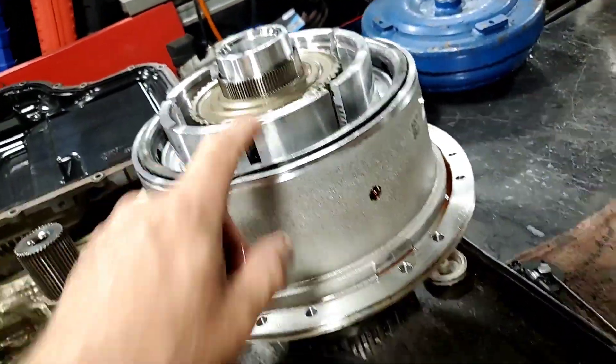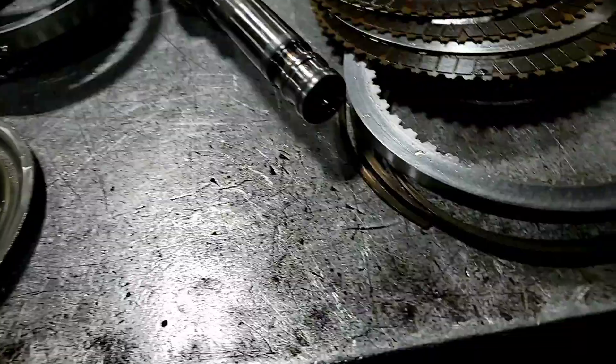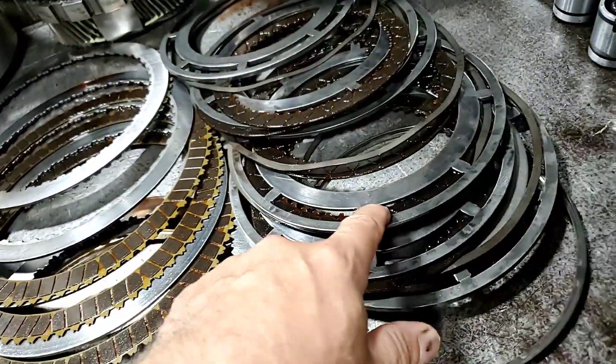It has 10th gear incorrect ratio and some other issues. This clutch backing part — that's the B clutch — no, that's a clutch that goes in here. This is the F clutch; it's a little bit burned up but not that much, just a little overheated. But these are burned, so this one needs the frictions and the steels — it needs both of them.